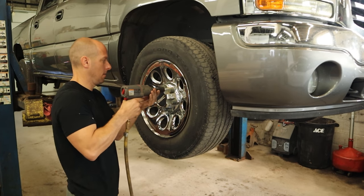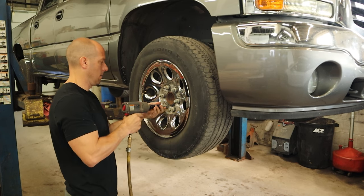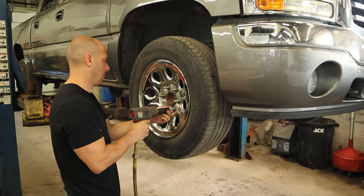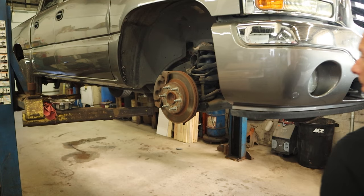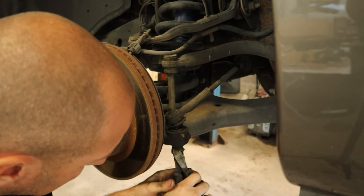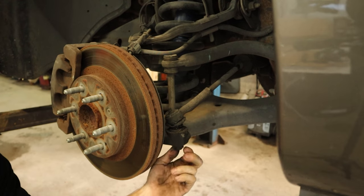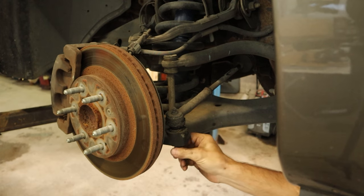Now we're going to pull off the wheels so we can put on our new tires and check the suspension and steering, make sure it's all good. Pull the little cap off and then pull all our lug nuts out. We got a loose wheel — looks like an outer tie rod end. We'll pull our little cotter pin out. Before we get too far ahead of ourselves, we're going to loosen up this jam nut, and then we'll spin the nut off the tie rod end.